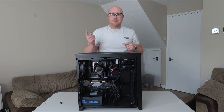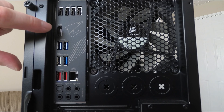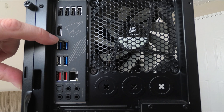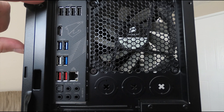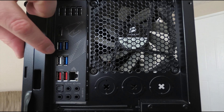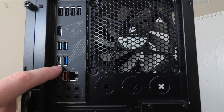We're going to spin the machine around and I'll show you the port used for BIOS flashback. Looking at the I/O shield on the back of the motherboard: at the very top there are four standard USB 2.0 slots, an HDMI connection, four high-speed USB 3.0 ports, two red USB 3.1 ports, gigabit Ethernet, SPDIF, and all the sound connections. Pay particular attention to the USB ports — four are blue for USB 3.0, but one is white, and on Gigabyte boards it's labelled BIOS. This is the USB BIOS flashback port.